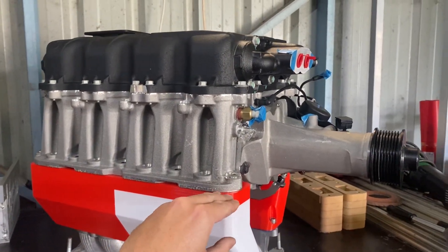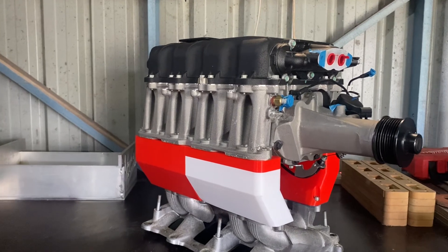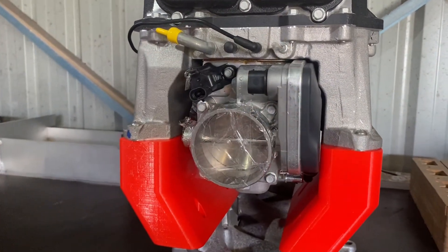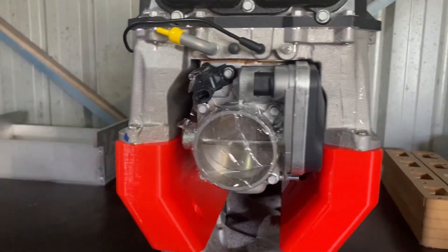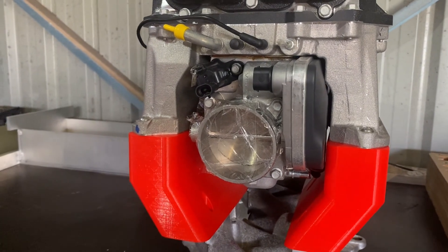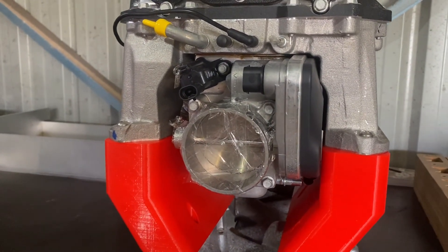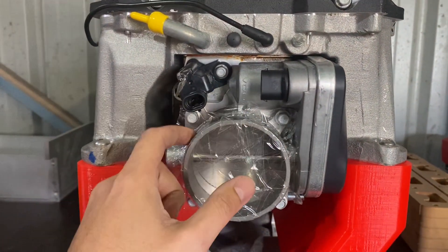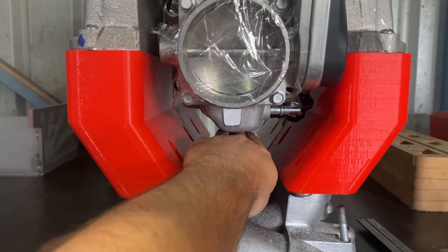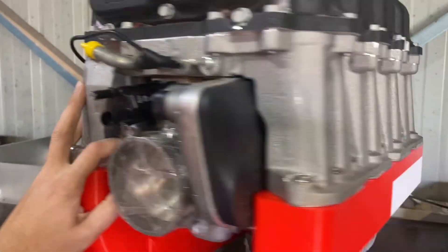The bonnet seam should be about here, so all of the supercharger is poking out nicely. The other thing to look at is the throttle on the back — the M122 uses a drive-by-wire throttle body from the STSV. I'm not sure yet whether to swap my ECU and go with the e-throttle setup or modify this to use a mechanical throttle. Currently I use a Haltech Elite 2000 which doesn't have provisions for drive-by-wire, so I could swap up to the Elite 2500 and add an electronic pedal, or I could plumb the intake piping in a 180 underneath and mount a mechanical throttle up front. Things to ponder — we'll cross that bridge when we come to it.